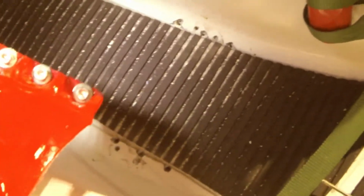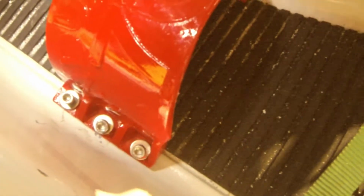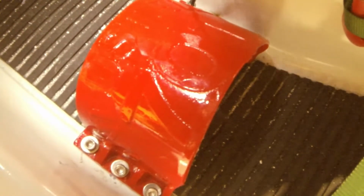Alright, I've got my holes lined up now. What I'm going to do is put mine in and start working on screwing it down. Now, one thing I will tell you, as I bolt mine down just for the purpose of recording, is when you do this, I would highly recommend that you use a little bit of silicone around each of the bolt holes, especially if you're in the same boat I'm in, where you had some holes drilled through for the X-lace or any other type of foothold. That just makes sure that you keep the water out of the hole. Just a little added insurance.